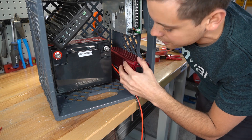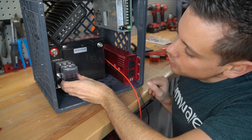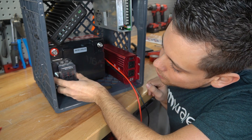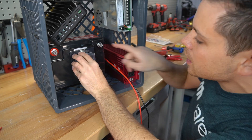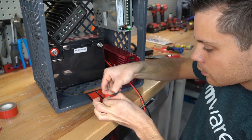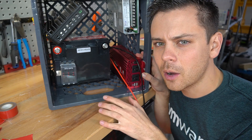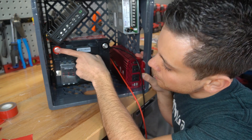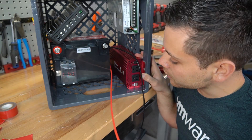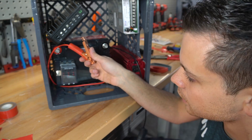You do not want anything that can heat up touching this battery. Now we need to mount the fuse block right about here, because we want the positive conductor going this way and not next to the negative one. Before we go further, we need to think about how we want to wire this — one positive conductor going from here to here, and then route this around and hold it with zip ties.